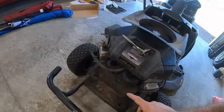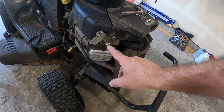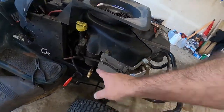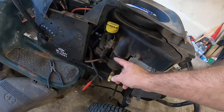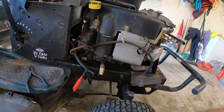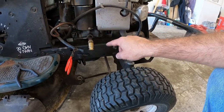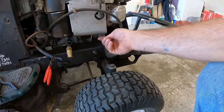So we'll have to disconnect the electrical. I've got the fuel pump and everything already off of it, because when I went to start it and bring it inside, the fuel pump took a shit and started spitting gas out all over the place. So we just got the engine electrical here — disconnect the battery and the starter. And then there's the drive belts and accessories down below, so we'll have to jack it up. There's four mounting bolts that hold the engine down and then the exhaust, and that should be it. Supposedly, from what I watched on other YouTube channels, it's supposed to take about two hours to do this job, but I guess we'll see.